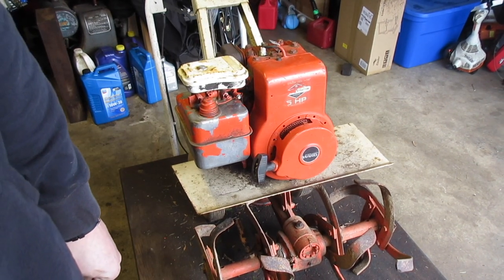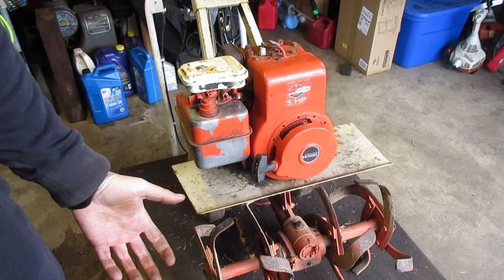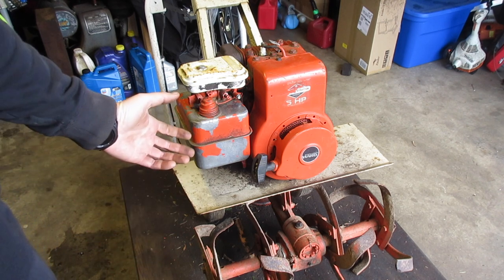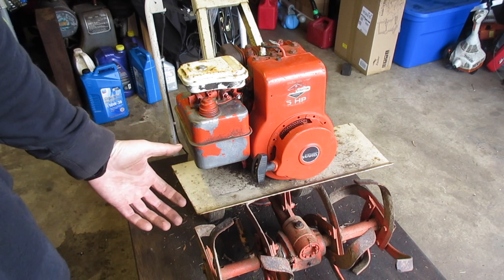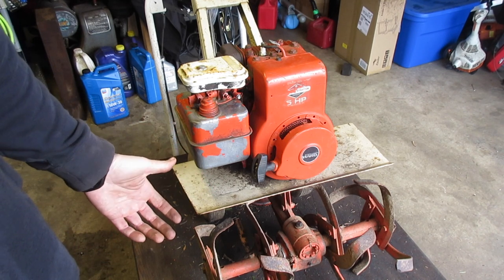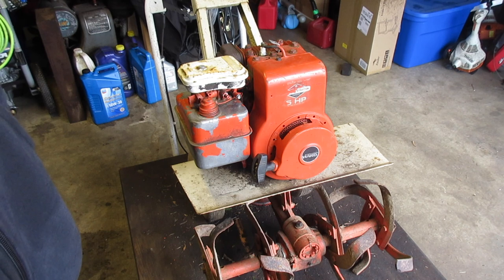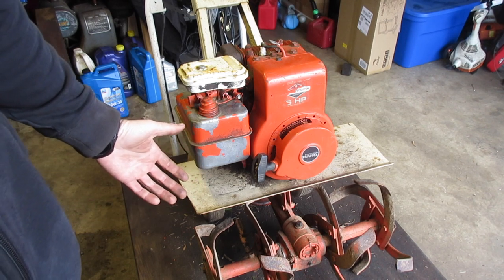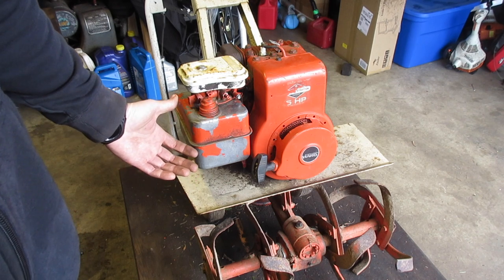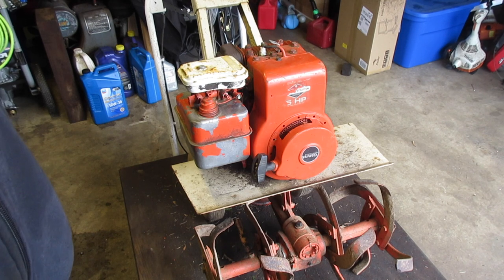It's bent a little bit, but it's probably not going to result in much, maybe a few hundred RPM if that. The carburetor itself has a maximum built in there, so you're not going to be able to do too much to begin with. I could potentially redo the governor, but I don't think it's necessary. It's probably doing 3,300. That's fine. You're not going to notice too much of a difference with the massive gearing down a rototiller does. There's no way those tines go anywhere near that RPM, so your power loss is even minimal.